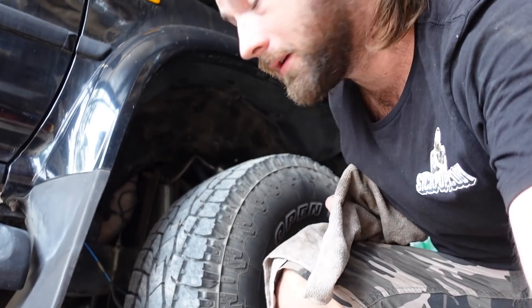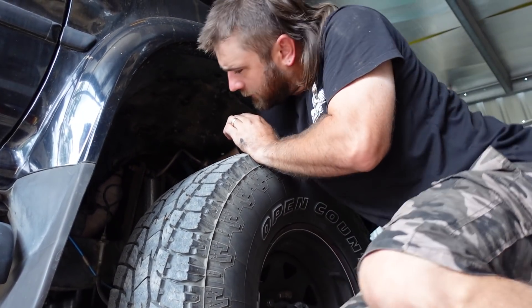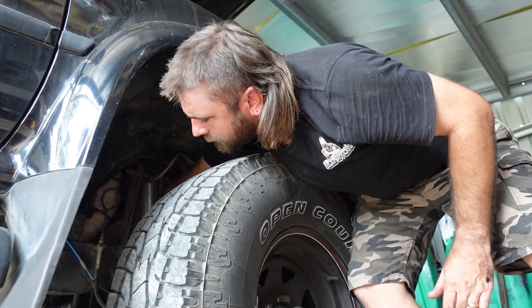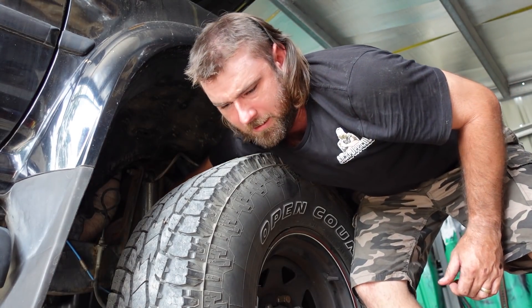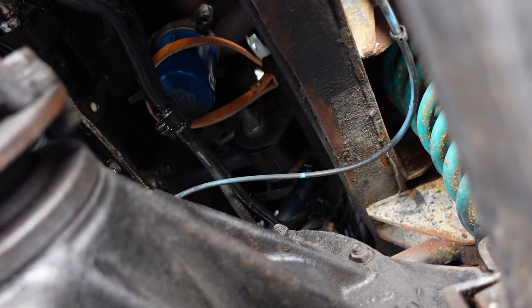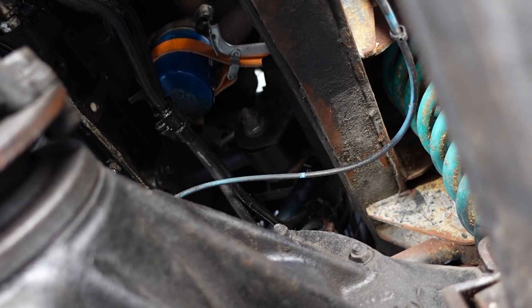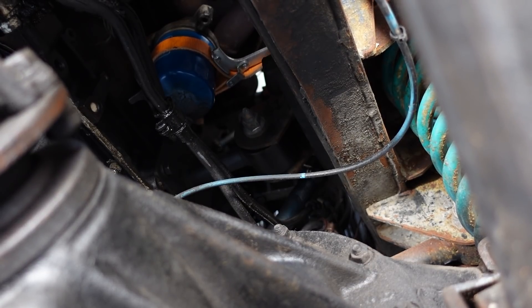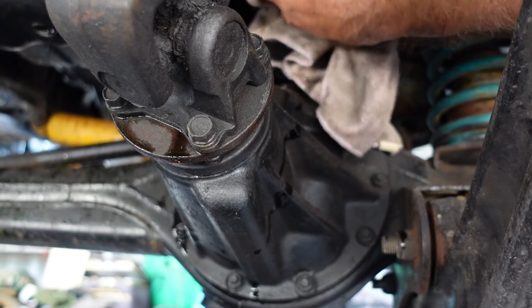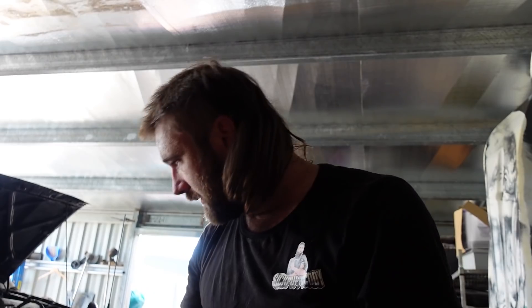While that's draining, the next order of business is to change the oil filter. Oil filter doesn't look that hard to get to — it's just in here. It'll be nice and warm. Nice and tight too. Got this flash oil filter strap — it's like a cam lock. Let me just crack the seal. That was hot. A little oil will seep out of that for a bit. Have a quick beer — sit in front of the aircon.